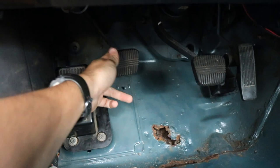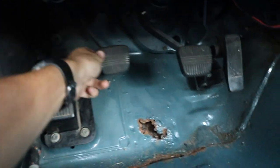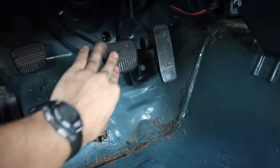Currently there is no resistance in the pedal at all. The pedal just flops to the floor — it's supposed to stay up and have a lot of resistance. It's just way too easy to move, so that's definitely something we need to fix, and the brakes are a little soft as well. Doing bleed jobs is always easier when you have a friend, otherwise it takes a lot longer going back and forth between the bleed screws under the car and the pedal inside. These jobs are a real pain but they're necessary to get the car driving.